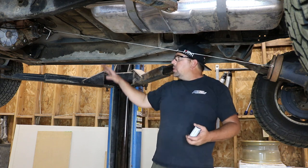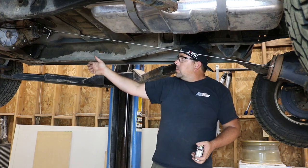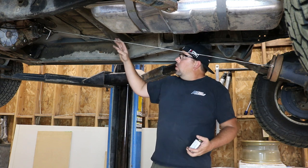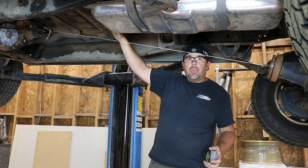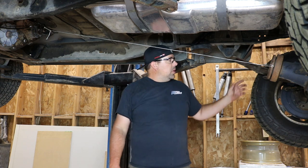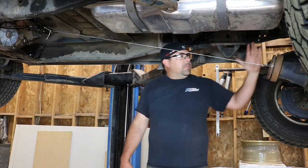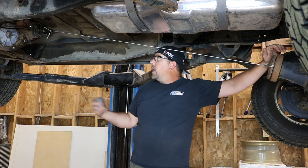There are a couple of ways to change the angles. Most of the time the motor and transmission are going to go where they go unless you're building a chassis from scratch. On this truck, the transfer case cannot go up because of the floor without cutting it out, and it cannot go down because the transfer case flange will hit the cross-member. The things we have control over: we can space the carrier bearing down from the cross-member to change angles, and we can put angle shims between the leaf spring and the axle to change this side. We can also adjust the leaf spring hangers or the shackle length. This is a fairly stock truck, so most of it should be pretty close once the driveline is in.